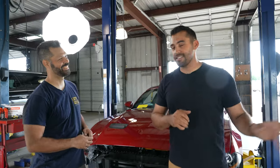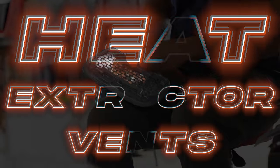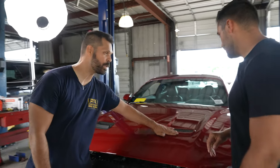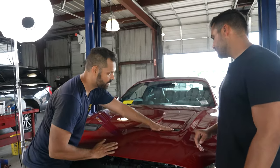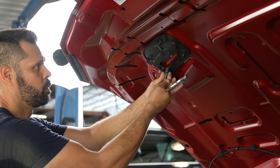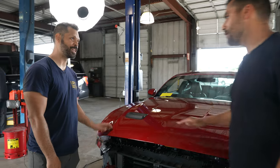It took about 40 minutes putting in the RTR grill lights, but we got it. These are our heat extractor vents for the hood. A lot of customers say — what's the benefit of having yours over the factory? The factory will get heat out, no mistaking that, but ours is a little smoother. When you're going down the street you have air coming over your hood and the heat is fighting that airflow to escape. We add this little lip here, so the air comes up and diverts, allowing that hot air an extra second or so to escape and pull it out with the air moving over the top of the vehicle. That small change — this lip — it's almost like a little spoiler. Yep, it changes the aerodynamics.